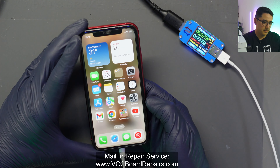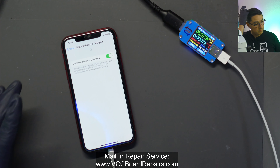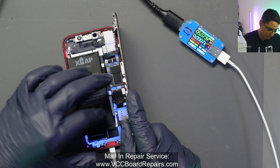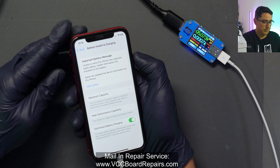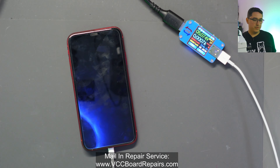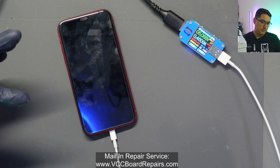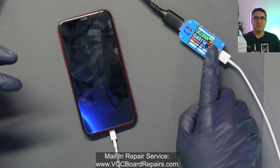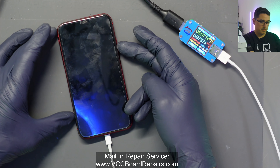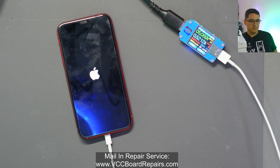We see the important battery message. Let me make sure this is fully plugged in. I'm going to turn it off using the power button sequence: up, down, power. I have to turn it off and let it fully shut down. You've got to go through this sequence because this is part of how it programs the battery. The USB meter is going up. Now I'm going to use the power button to prompt it to boot — three, two, one. Apple logo. Now we wait.